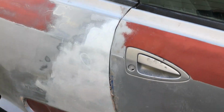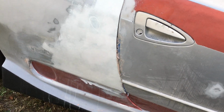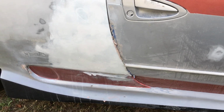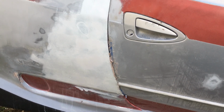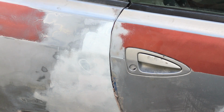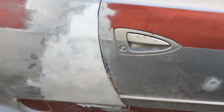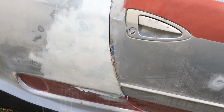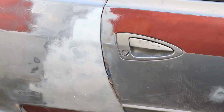Okay, so this is the rear firewall. The rear core panel that I had to pull back out with a come-along. I weld a hook to it and then I pull it up with the come-along. So there's a slight bend to the left end, so I went ahead and filled it with fiberglass, just the glass epoxy. Then I put a light gel coat over that too. That just has to be wet sanded and then primered and painted, and that'll be done.